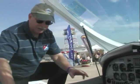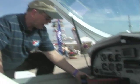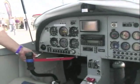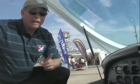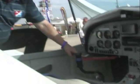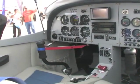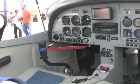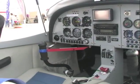One other nice little feature they've added in here: a control lock. Instead of taking the seat belt and tying it around the stick, or putting things on the elevators and ailerons that you might forget — which is not a good thing — here's a very simple way to lock the control surfaces in case the wind is trying to flop them around when you're not at the airplane. Just a couple of pins, a lightweight piece of aluminum that grips the stick firmly and holds everything just where it ought to be. I like it — good stuff.